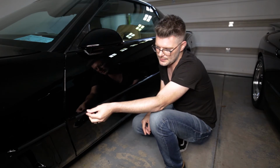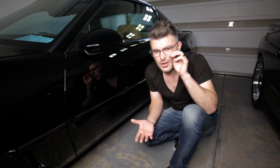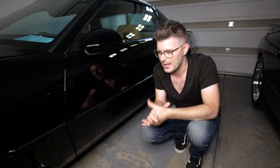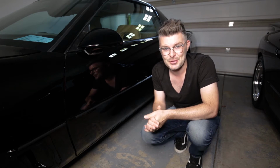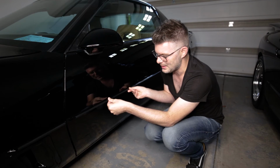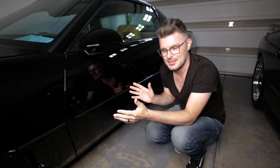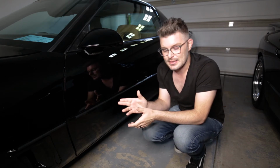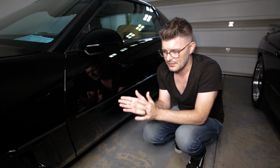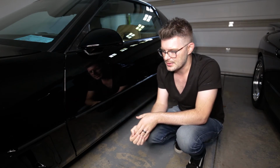When putting this vinyl strip in, you're going to want to make sure that you're installing it in about 80-degree weather. That's going to give you probably the best fit, because when it gets cold, you'll notice that this rubber vinyl piece actually shrinks, and when it gets really hot outside, it's going to expand. So if you're cutting it to size, cut it in about 80-degree weather, and that should give you enough room for it to expand and decrease in size.